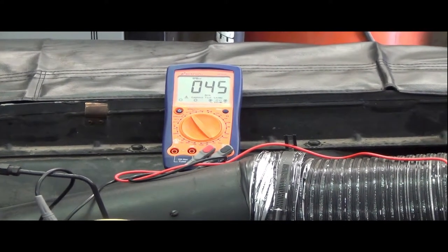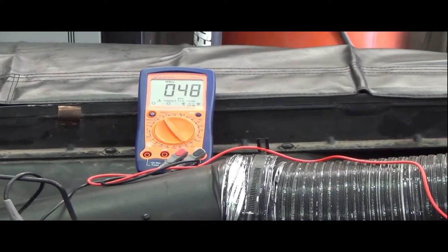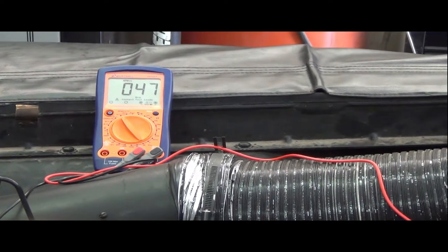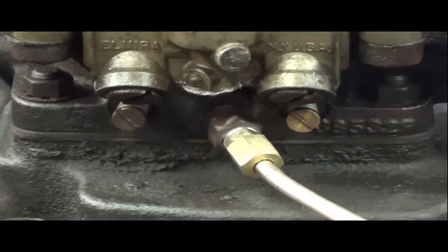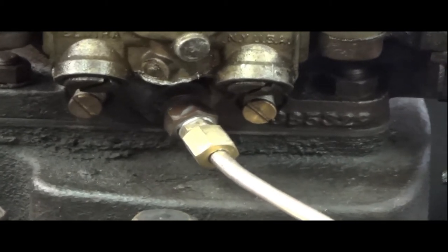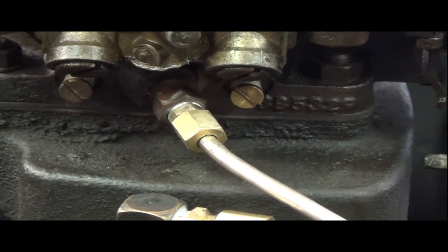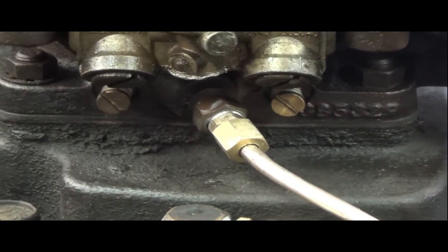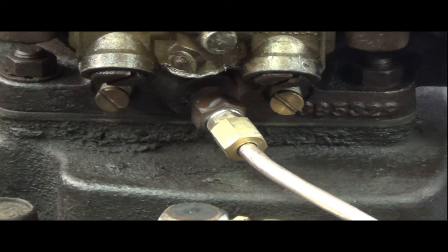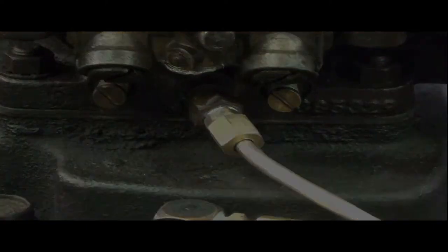We'll go ahead and finish out the adjustments on it here to see if we can find the best spot between too lean and too rich on the idle screws. But that's pretty good. That's pretty close. So I had moved them both in until the cuts were just straight up and down. That's when it started to roll a little bit unevenly, maybe starting to struggle. And I stopped and put it back to where we were. Let's see how rich we can go before we start changing idle, and I'll go out a little more.